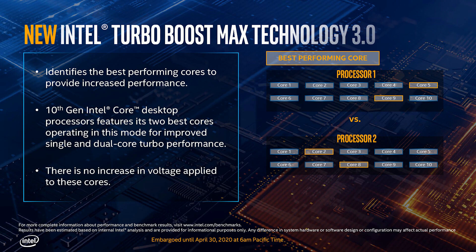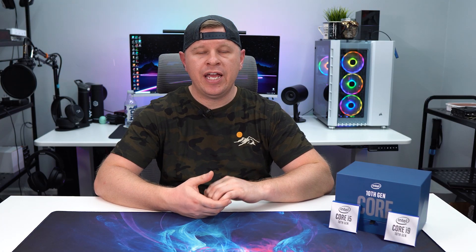Intel has made some improvements with these processors — not just increasing frequencies, but new features have been added. You're going to get three different boosting algorithms. First is Turbo Boost 2.0, which has been on Intel processors for a while and is available across the entire range from Core i9 down to Core i3. The second is Turbo Boost Max 3.0, available on Core i9 and Core i7, which adds favored cores so your OS will be aware of the two physically best cores that can sustain the highest boost frequencies, and the OS scheduler will prioritize running workloads on these cores.